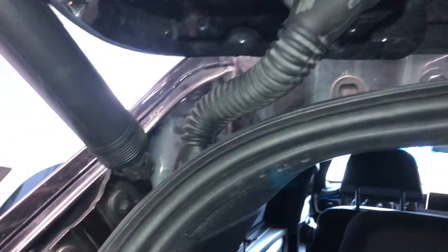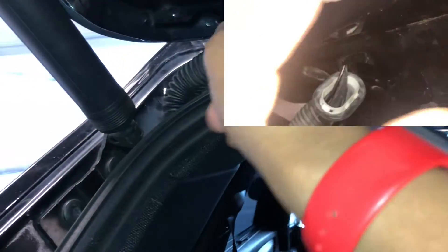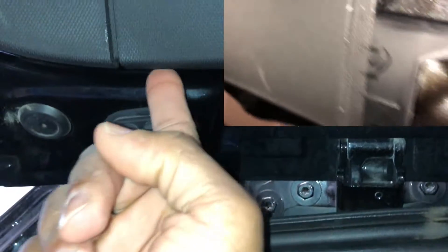You can see the rear camera there. I initially mounted it on the glass itself, but I had the tint shop apply tint on top of the factory tint, and when I was moving the camera around I ended up pulling off the film slightly at the edge — so be careful if you have any additional tint beyond the factory tint. I pulled up the weather stripping, undid a little clamp, and fished the wire through a small hose where factory wiring already runs for the rear hatch. Once through, the panel I mentioned comes off and I coiled the excess wire inside it.